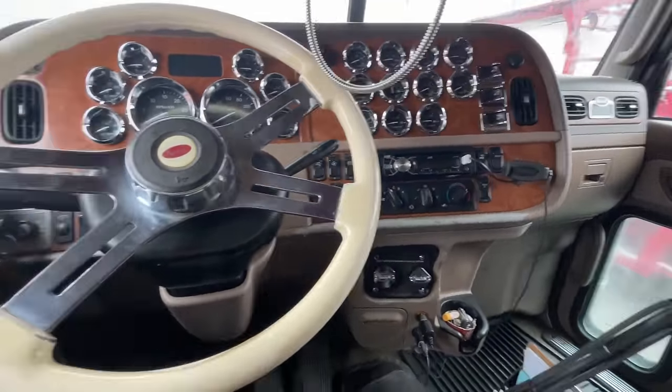It's a little funky to try to explain like this, but when you're actually moving down the highway, it kind of makes sense because that middle part, when you're in a gear, pushing the clutch, pop it into neutral, release the clutch, that actually engages the transmission and spins it up to approximately the proper speed that you're going to want for the next gear. And the reason you use the clutch is it kind of softens the shift in between every gear.